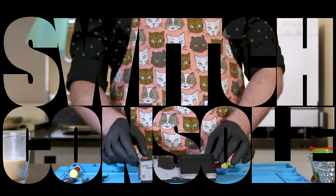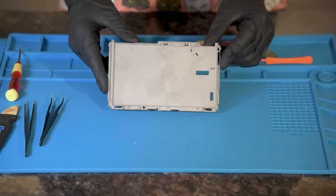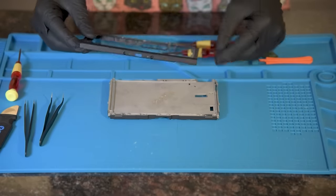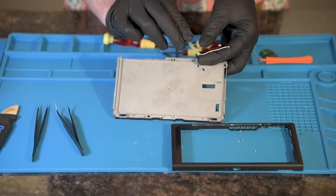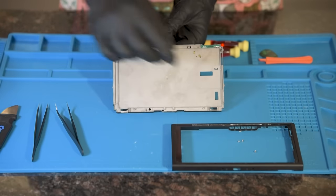The tablet of the Switch is, in my opinion, the simplest to complete. First up, start with the iron base. The ribbon cable holes will be on the right, facing you. Get the front shell ready, but do not place it yet. Install the short white antenna in the slot on the top right. The wire goes in the smaller hole on the top right.